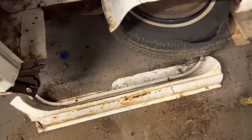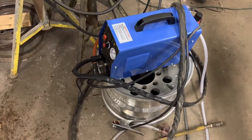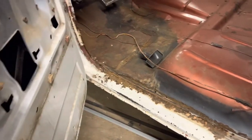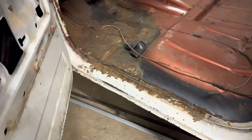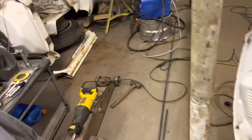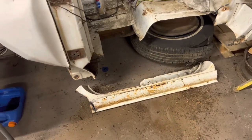I just got the rocker panel and that little hump piece cut off that I need. I used my plasma cutter — that's a new cutter, I'll link it in the description. It worked pretty good. I'll make a template off of what I need on this truck, put it on the rocker I just cut out, then cut it off the donor rocker, cut this rocker, and set everything in place. It's a pain in the butt but it's better than spending the money right now. This is DIY budget build stuff.